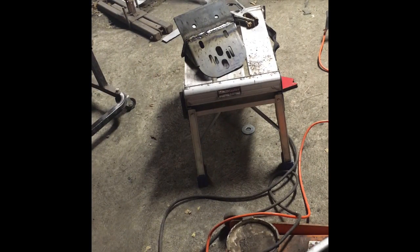Okay, well, that's welded up here now. We're going to let this thing cool because it is hot, hot, hot, hot, hot. But just to give you an idea, got a little bit of porosity in two or three spots there. We may clean that up and re-weld that. This is a suspension bracket. There you go. There's a nice weld for you.